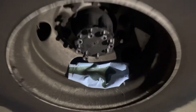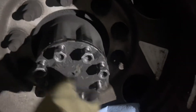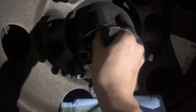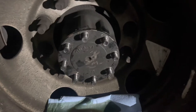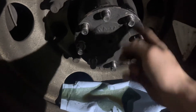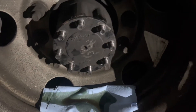So how we're going to do this — you can see I kind of got started — you can remove these eight 15/16th nuts. I would advise wearing gloves for this because it is a very messy job. On some trucks or trailers it's a little different; they've got lock washers in here and you have to take a chisel and pop those out. Luckily with this truck — I'm working on a 2020 F650 — it does not have those.